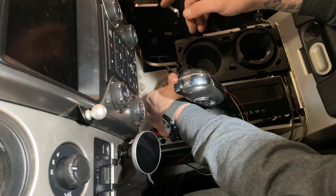Sometimes with Fords they do weird things when you start unplugging things, so let's go ahead and disconnect the battery first. Now with the battery unplugged and the instructions pulled up — the instructions only cover this pinning part, which is why I made this video — the wires go into the top row of the connector. Pin three is the red wire, pin four is the white wire, and pin five is the black wire. There are little color-coordinated dots. You count from pin one and insert accordingly.